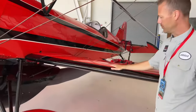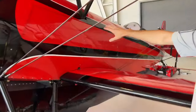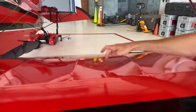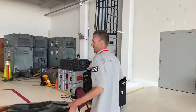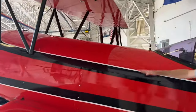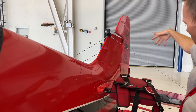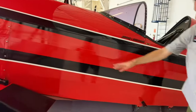The aircraft has a steel tubing fuselage covered with carbon fiber on the top and aluminum panels on the side. Behind that is fabric. Wings are wood and fabric, with some steel in them as well. All the flying wires come around to the side. Carbon fiber runs along the entire top and stops here — so the shell on top is carbon, and this is carbon as well toward the back. Then it comes back to the vertical, and the rudder, elevator, tail, and everything is fabric. These side panels here are all covered in fabric over steel tubing.